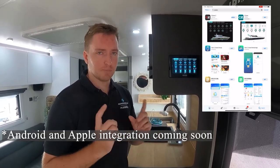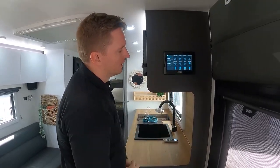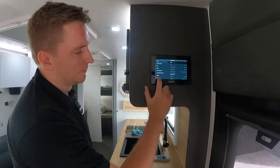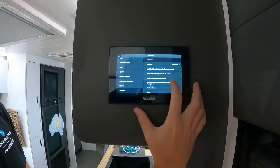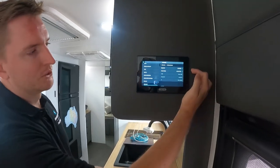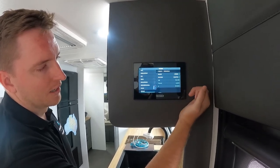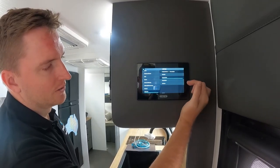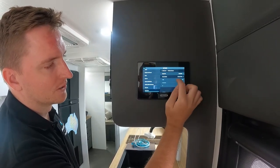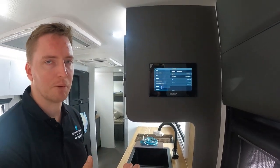No exact time frame on that, but it is coming. To set it up, tap the three little lines at the top, go into your settings, scroll down to the bottom and you've got an option that says advanced. Within there you've got the wireless server option. Straight away you should have a dip switch displaying — you don't need to change that, it's preset by us. You should have an option that says access point. Sometimes you may find it's in disabled or client mode — just make sure it's in access point, as that generates an SSID and a password which are the two important parts.